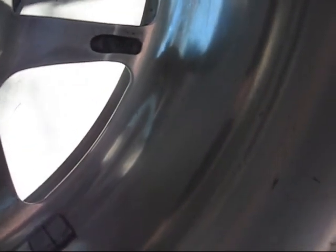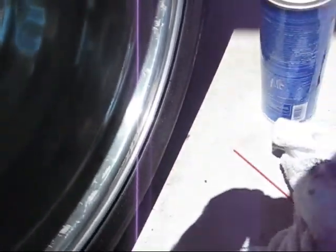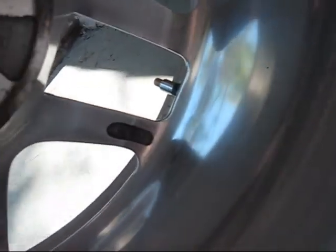Okay, there you go. It's all cleaned off. What I ended up doing is using my fingernail to get the aluminum tape off, and then I sprayed brake cleaner onto the rag and then used the rag to polish off the adhesive, and that way I didn't have a lot of brake cleaner running around to other parts of the wheel. Now if you have hammer-on weights, then you don't have to bother with this at all, but on these wheels I like stick-on weights. So that's that. Now you might use a little bit of brake cleaner on the rag to clean up any other little dark spots you see inside here.